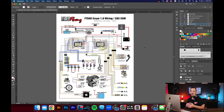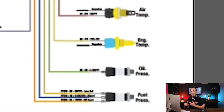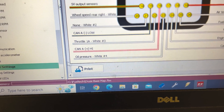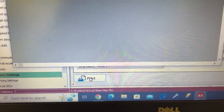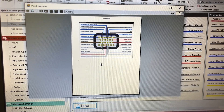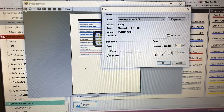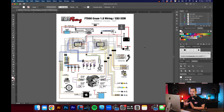We also need to get all of our other readouts such as intake air temperatures, engine cooling temperature, oil pressure, and fuel pressure. Once we told the FT software what outputs and inputs we're looking for, it spat out this diagram. I printed it as a PDF, brought it into Adobe Illustrator and kind of connected the dots. You could do this with pen and paper, but you'd need a lot of paper. One great thing about doing it on the computer is being able to hit undo.